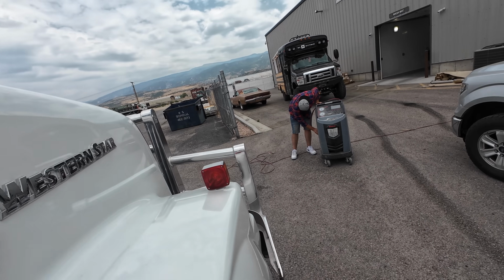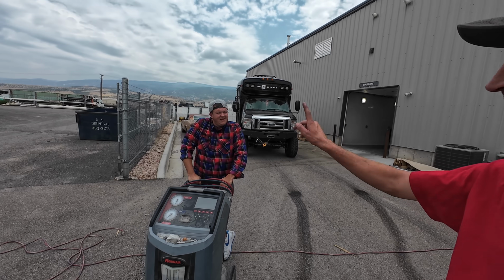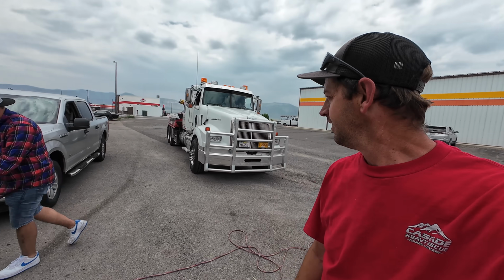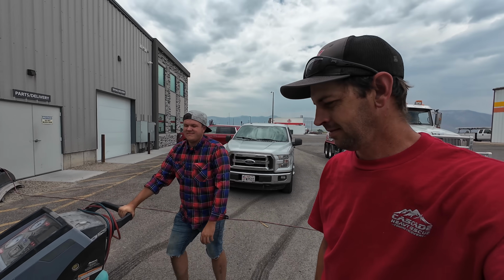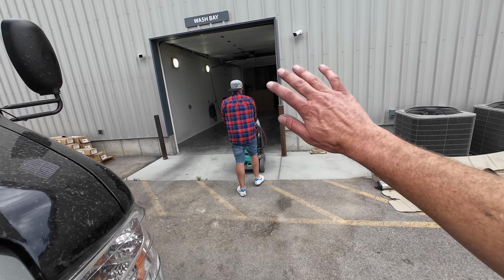Well, Robby, how'd it go? You know what? It's not my fault that you drive a Western Star, okay? Ooh, fighting words. I'm just kidding. Didn't go well. So they topped off the charge, that was not the issue. They said it's either the expansion valve or the compressor. So not a body shop. Not something we could fix with an AC machine. Thanks anyway, Gilligan.